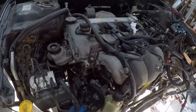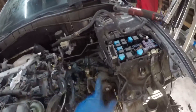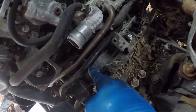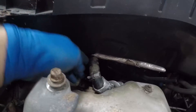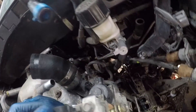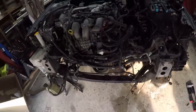I'm going to look around the car and see if there's anything else connected to the body. I already got this ground off over here — it goes right here on this motor mount — but I don't see anything else connected. So if I can't find anything else, I'm pretty much ready to get the hoist out and hoist it from right here and take the motor mounts off. I did find one more thing — actually two — the heater hoses. There's one here and then this is the hard pipe for the other heater hose. There's a little plastic clip right here holding this hose and then you can just take this clamp off and that should be free. The top one I just disconnected right at the core because it was easier to reach. So I'm pretty sure that's everything. I'm going to make some room and get the hoist out.